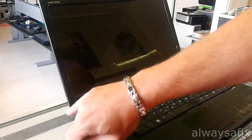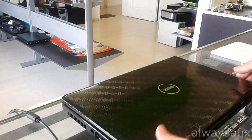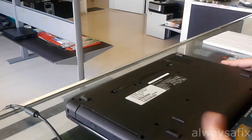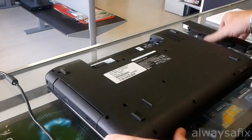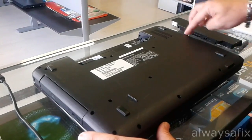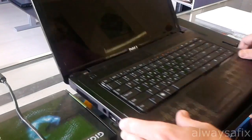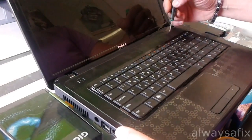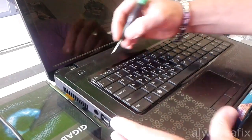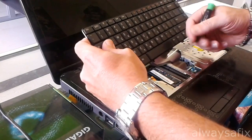So just power off. This repair — you're going to need to take the laptop apart. What you want to do is remove the battery, remove all the screws that you can see from the bottom. Along the top of the keyboard here, there are four tabs that you just have to push in. Release the ribbon cable.